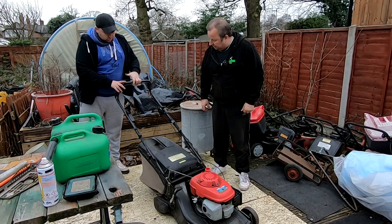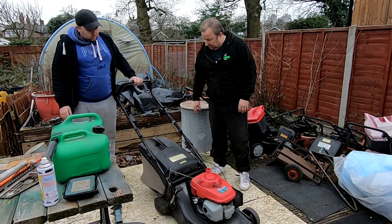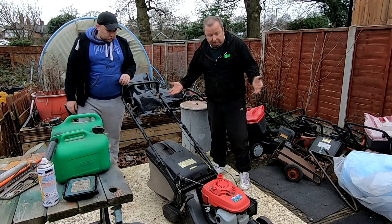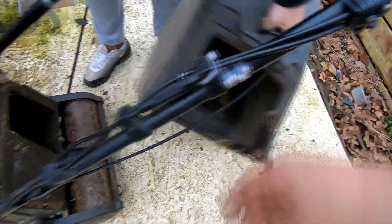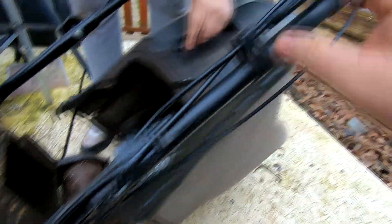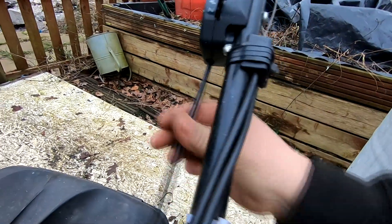The drive works as well, how about that? So yeah, it might be okay to work on. We've got a new spring for that governor arm mechanism to get just the right tension on it. And as you can probably see, someone's obviously just kept it going - things like these cable ties here, old tape around here where he's probably gone through the cable. We just had an old cable and made a new connection in there - we cut the outer sheath off an old cable which was way too long, and that's what we've done there basically.